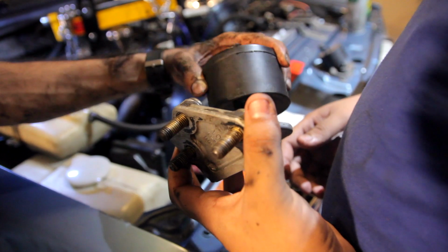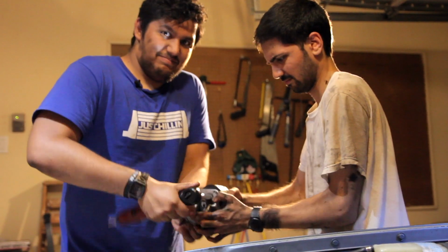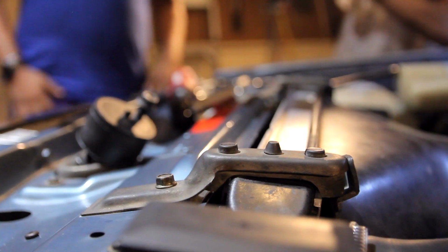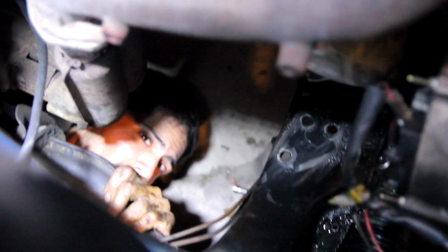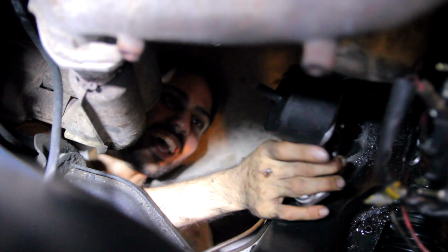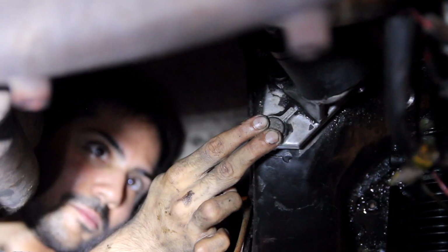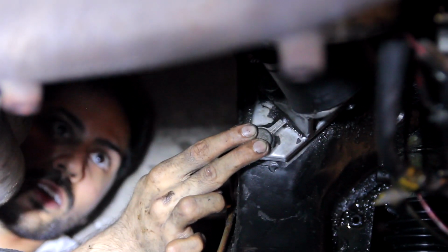After kicking David Attenborough out of my house, I hosed down the engine mount bracket and then took it inside to reinstall it. This isn't the way they said to do it in the manual. After awkwardly installing the mount to the bracket, Zain went back under to bolt it up. After loosely bolting the mount to the engine, lower the hoist until the bracket lines up on the subframe.